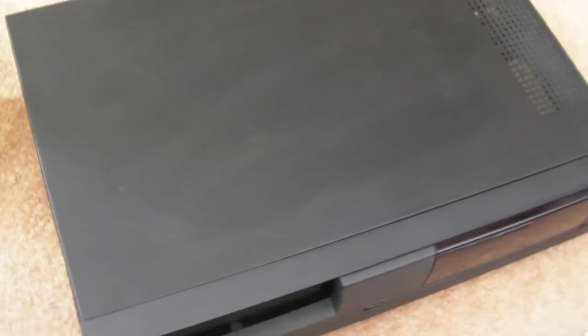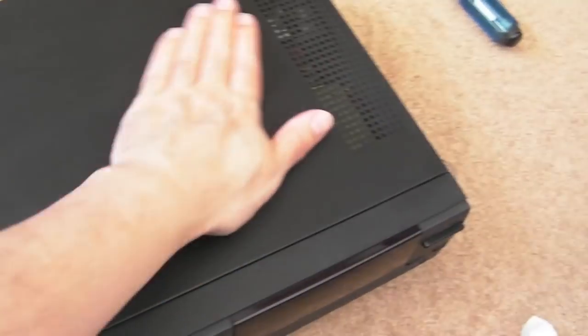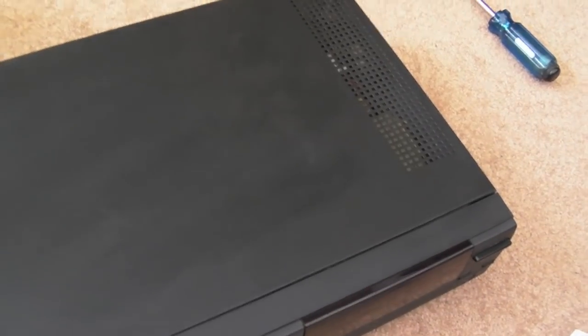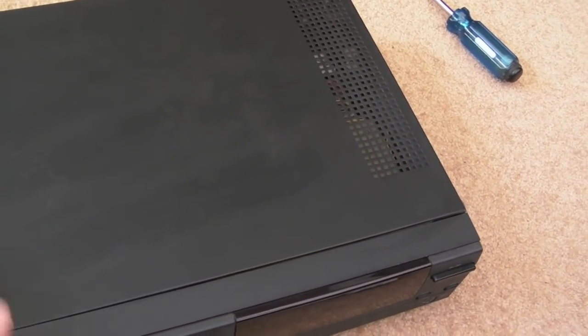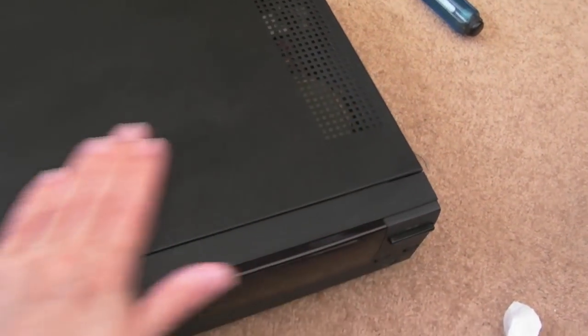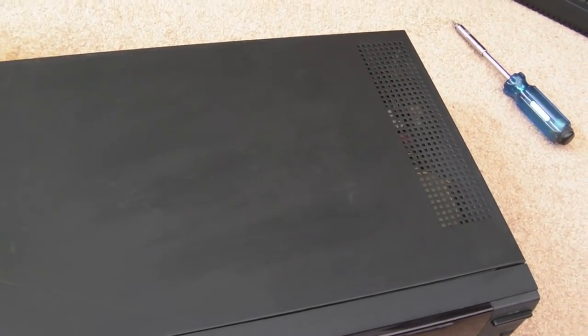So as you can see, I got rid of all the white marks with plastic cleaner. Now it looks a bit patchy, but it won't in a minute, so I'm just going to wipe this down with a bit more soap and water, and then if you spray over this with a back to black, it should look pretty much good as new. Still a bit damp there as it's drying, but the key is going to be to get some of this in, because like I said, the plastic's dried out. I've used a bit of IPA in places, but mostly Meguiar's PlastX. That's the thing that got all the white marks off. So that's actually pretty good.